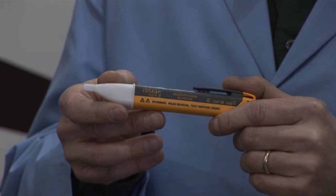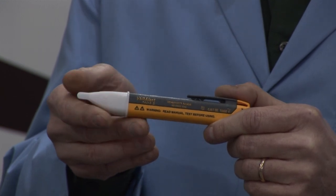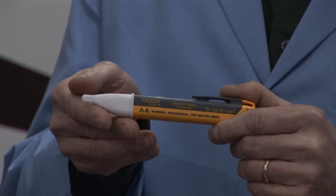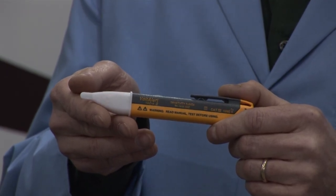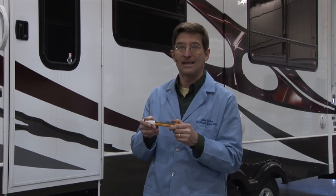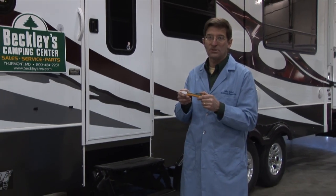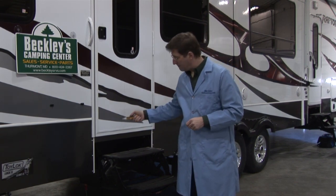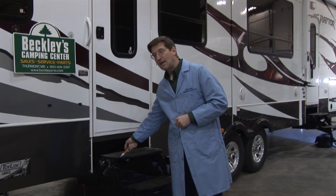Basically you push one button to turn it on — it does a little beep beep — and you can see the light is blinking every couple of seconds, indicating it's in sensing mode and ready to look for electrical voltage. This is exactly the same unit you would use for testing a power outlet in your house, but we're going to use it to check the RV skin. A good place to test is right on the door frame or the steps, because the steps are always tied into the frame of the RV. I'll point it down at the steps — you can see it's just blinking every couple of seconds, meaning everything is okay.